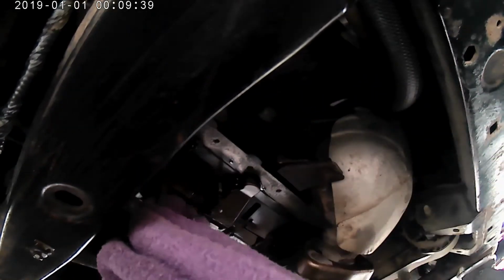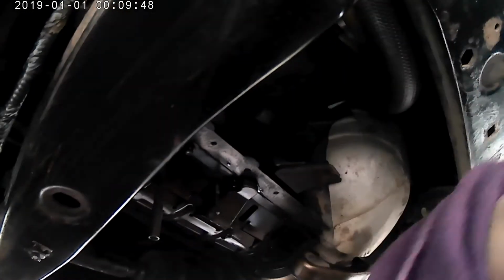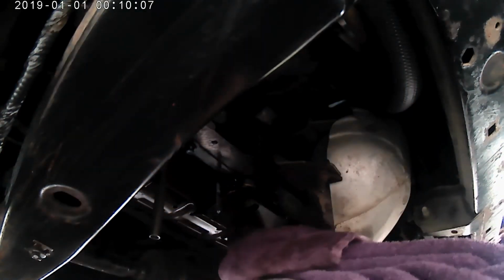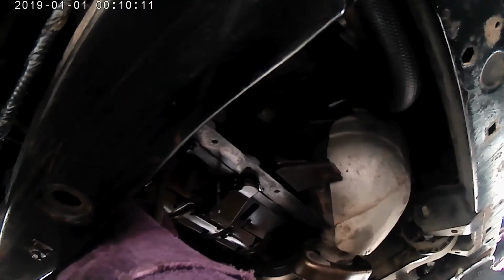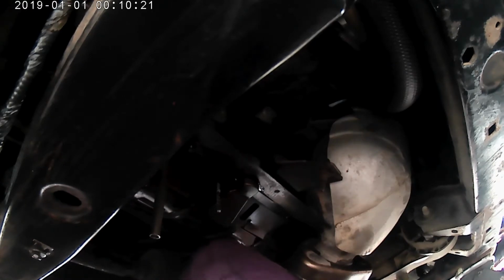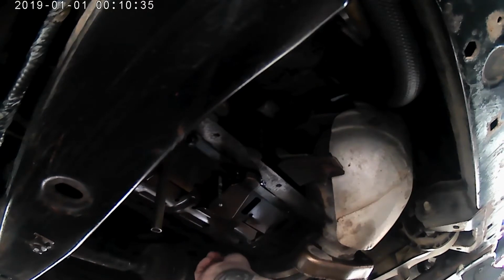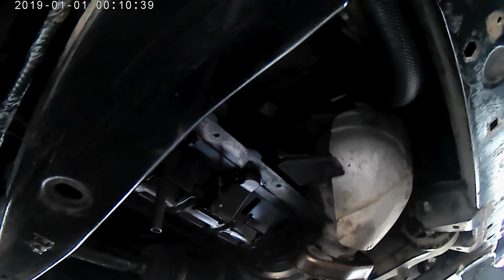He's also having some issues with his turbo on this car. We found a line that runs to the waste canister and to the blow-off valve, to the wastegate, and the blow-off that was unhooked. So obviously the turbo couldn't spool or release properly. So now that those are hooked up and he's not going to be leaking oil and blowing oil all over the top end of his engine, I would, in my opinion, say that it's going to run much better and the turbo is actually going to do what it's supposed to do.